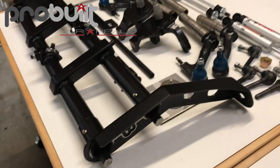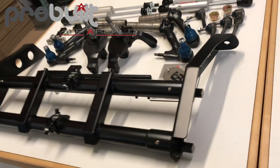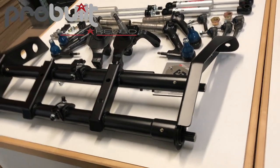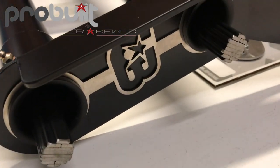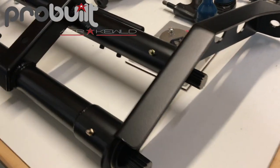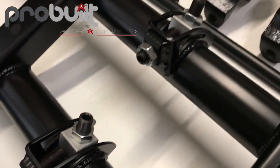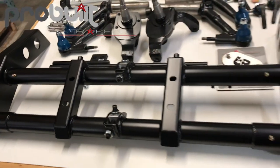First, you'll notice that we have our narrow beams. Most people purchase the 4-inch models. This is actually a 2-inch model, but we can do them stock width, adjustable, narrowed up to 6-inch. All come with Delrin bushings, Volkswagen of Mexico torsion bars, powder coated satin black, game changer adjusters, which means 7 1/4 inches of adjustability up and down. No other beams do that.